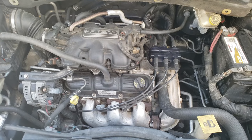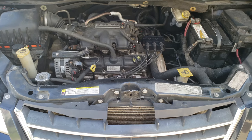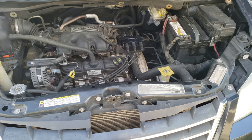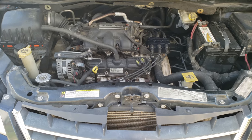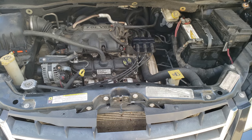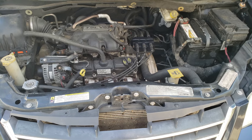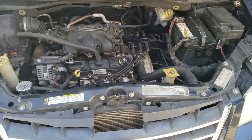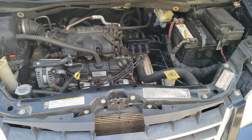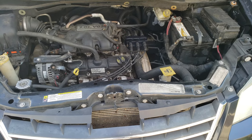She started up. On this vehicle I was getting a few different codes: P0301 and P0304, which is a cylinder four misfire. After I quickly switched out that plug since I was on vacation, it moved to P0301, which is a cylinder one misfire. That led me to believe the issue was actually the coil pack, since it kind of migrated as I was trying to address it. Once I get back, I'm going to switch out the wires and the plugs and put some iridium plugs in there. The dealer last time put double platinums in there, which last about 60,000 miles, and it has been about 60,000 miles since they were switched. So that's about it for that quick change of the coil pack.